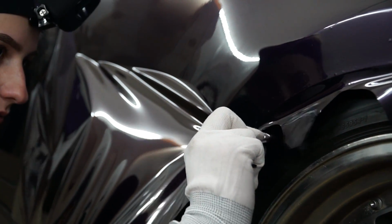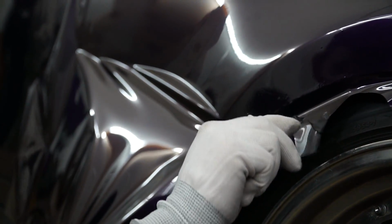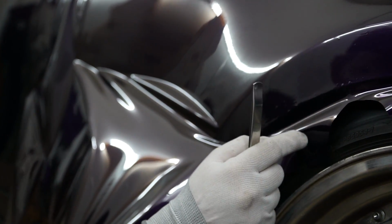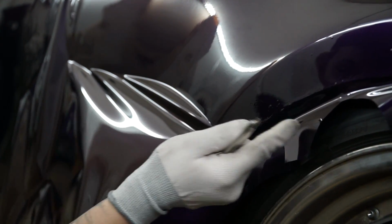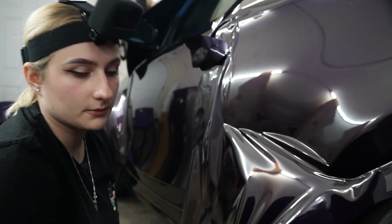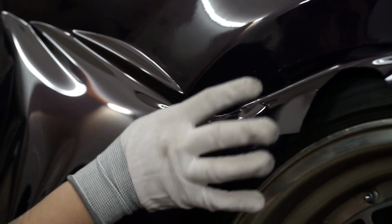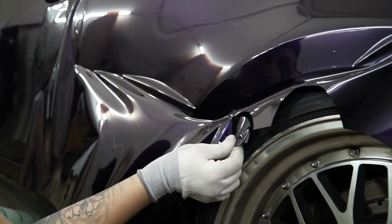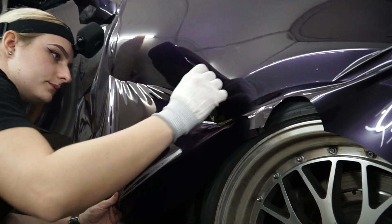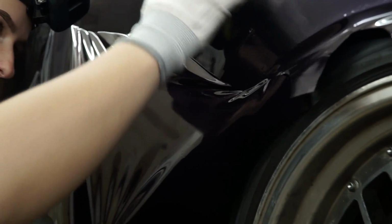Make sure that when you are relief cutting it, the one thing I do is called J cuts. Instead of trying to do a straight line, because if you do a line like that and you start pulling this way, it'll separate and continue on and you'll rip your vinyl and you'll be really mad. Don't do that. J cuts are really nice because you pretty much round out your cut, and then it'll also allow you to move out this way without tearing on you. Okay, put a little bit there. And continue very slowly feeding the material.